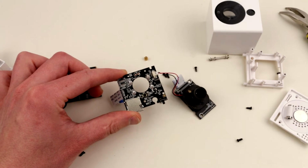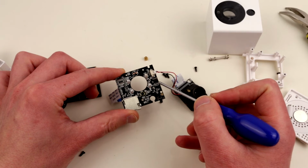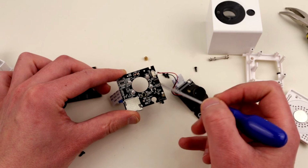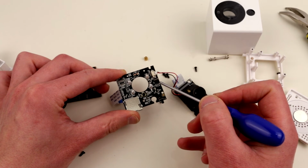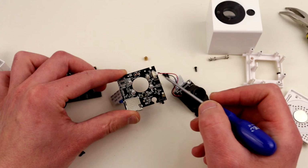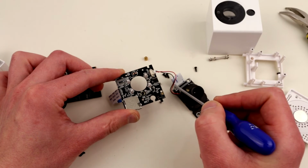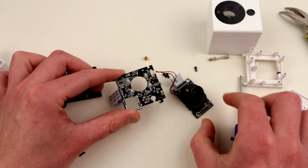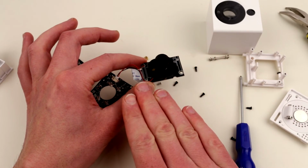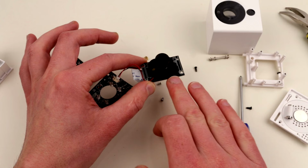It turned out this guy is CHMC S68 or D6216218F, and it took me some time to dig it up, but it turned out to be an analog of BA6208, which is an infrared filter driver. It's a motor driver apparently, and it turned out this is not just power for the camera, this is to drive the infrared filter, which works like a shutter. When this camera turns into infrared mode, it's like click, and it covers up, and as you see it turns almost black and white in the dark.